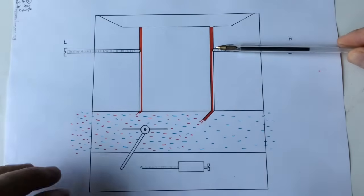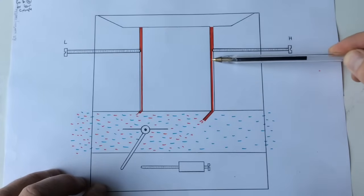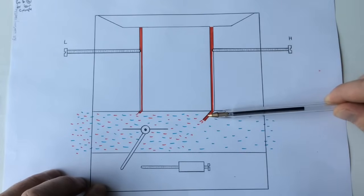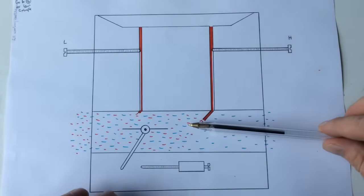...it needed more fuel, it needed richening up slightly. Richening it up means giving it slightly more fuel - unscrewing it slightly more, just a quarter of a turn if that, just richens it up with fuel that little bit more and allows more to come down.